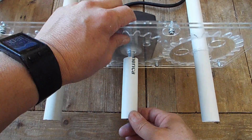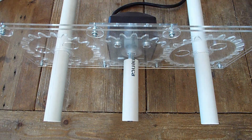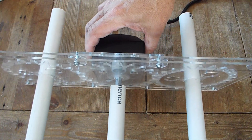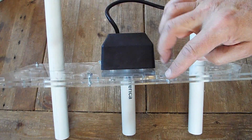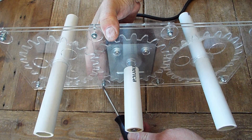Alright, so that's set on there — it's not going to move back and forth. The reason I wanted to show you after it's set up was you'd wonder how you can take off the rotisserie motor. Well, the rotisserie motor is actually mounted to this mount plate back here, and all you need to do if you ever have to replace your rotisserie motor is just undo the four nuts back here.